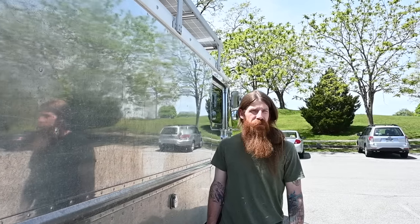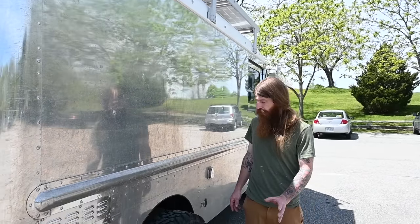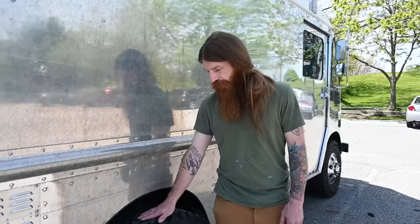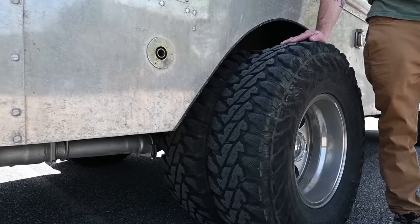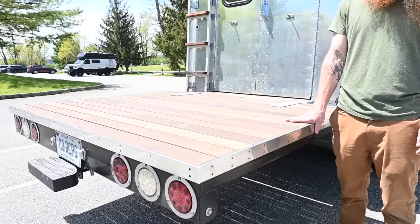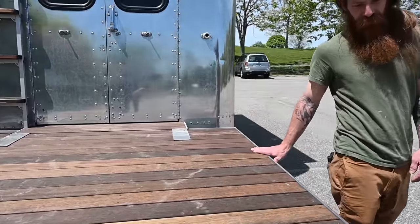On this tube chassis, I needed to accommodate the original 10-foot wheelbase of the original body of the van, so I built the frame around it and shortened the stock driveshaft. That way it could fit the Dana 80 rear end to allow for the amount of weight this van has. It has a rear tailgate with hydraulic fold-ups on it, so it can fold up out of the way and support an ATV or any dirt bikes on top while still towing a boat.